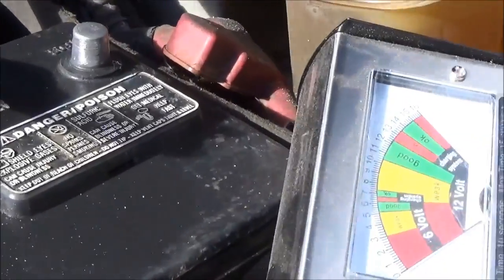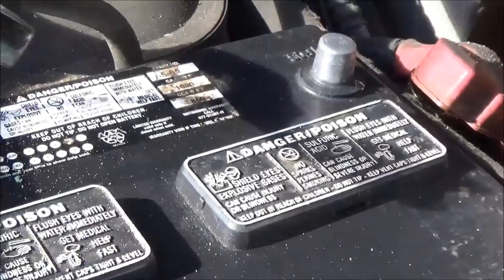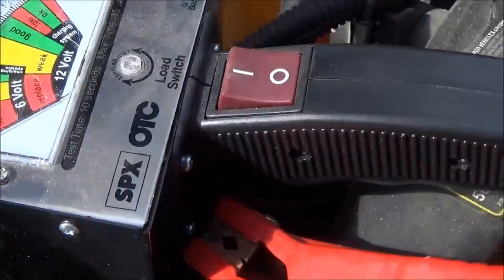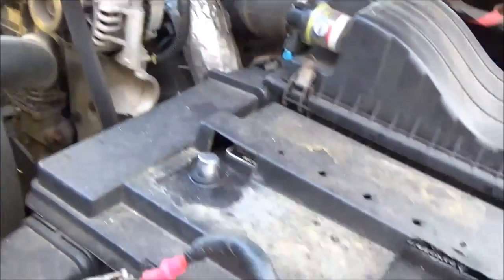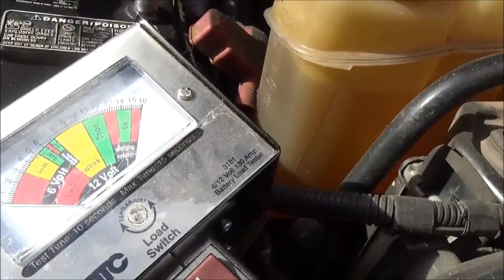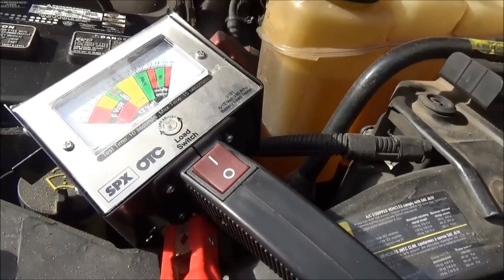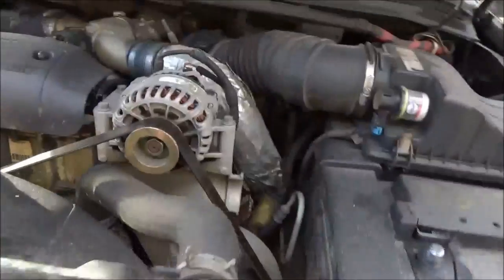Okay, next day here. I did load test the batteries and did a little maintenance, which I probably should have done before the trip. Cleaning up the terminals, as you saw, were not so good. Load tested both batteries — they're great, so not a problem there. I put the load tester on the alternator and it showed the charging system to be low, even below low, and it was intermittent too. Pretty much diagnosed the alternator as shot.